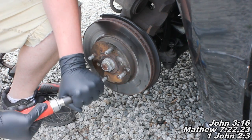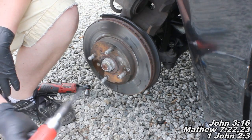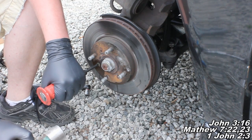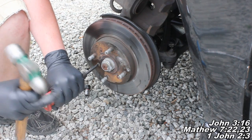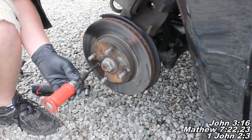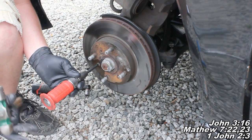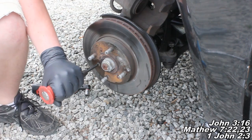We're going to spin it back so when we hit it, it's going to spin it left. The idea behind this tool is you're going to hold it up against that screw, then take a 32-ounce hammer and bang on it. When you bang on it, it's going to twist the screw. So you're going to have a really good grip because at the moment of impact, it's going to be turning — you don't normally have that kind of grip on the screw. So I'll go ahead and start by using this method.